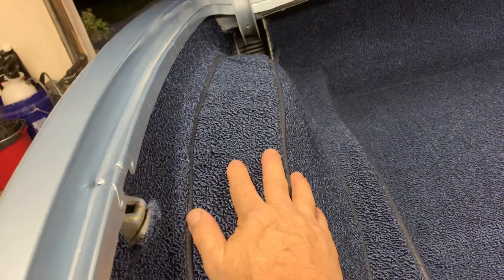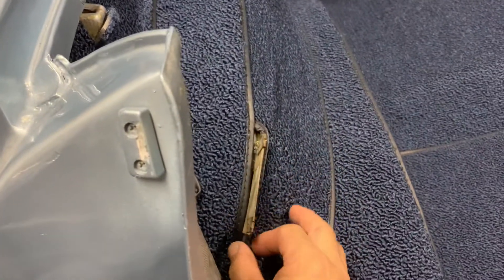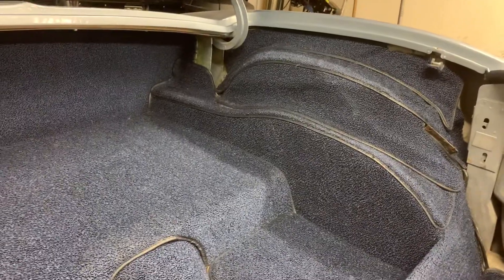After the wheelhouse, you put in this piece — you'll see it in the kit, it's got a slit opening for the trim panel that goes for the top and two screws, so you install those on both sides. Then you do the backing — just two little pieces of carpet that go all the way around on that side too. Once you've got all that done, then you put in your diff cover carpet.